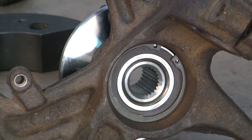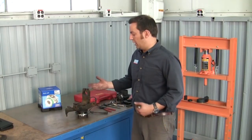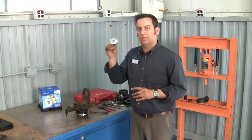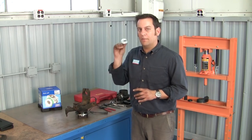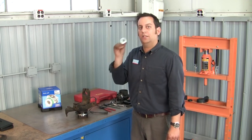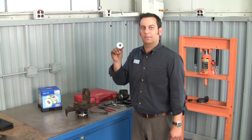Finally, we're back to the ABS speed sensor — we're going to go ahead and install it. Now that we've removed and replaced our Generation 1 press-in bearing and hub, it's time to install it on the vehicle. Once you're done installing it, always remember: if you have a crimped, nylon, or 'do not reuse' axle nut on that vehicle, you must replace it. And when you replace it, you always need to torque that axle nut to OEM specifications. When choosing a replacement hub, don't compromise safety — install confidence with SKF hubs, bearings, and seals.